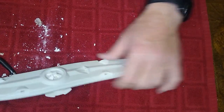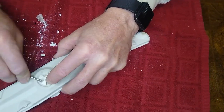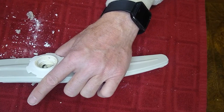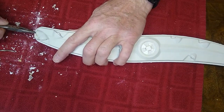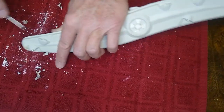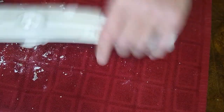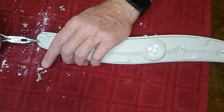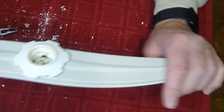We'll just go through and look and make sure they're all cleared out. I can see why our dishwasher has not been working very well — let's get this cleaned out. We'll just go through one more time and look at each port and see if we can get it cleaned out any more. Once you get out as much as you can, put this underneath your faucet and try to get out all the stuff that's in the chamber. Now you can see all the debris we were able to get out of that upper arm.